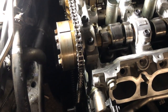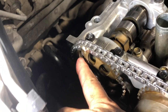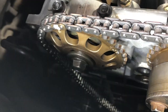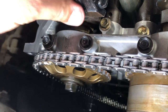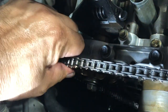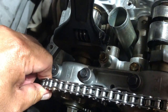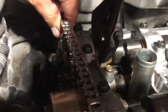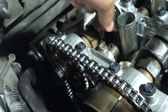If I let go it stays in place. But looking at the exhaust side, I'm a tooth off. I'm going to turn it — see how I can fit this — I'll do my best. It's just not working out well. I'm going to lift up on this chain and see if I can get it in place, but I can't because my wrench is sitting right here in the way.